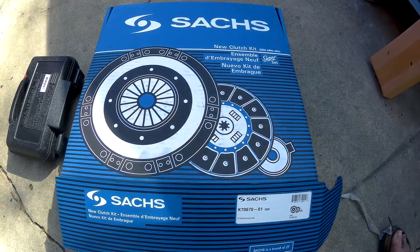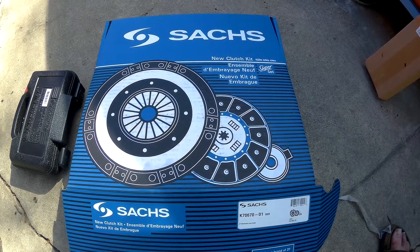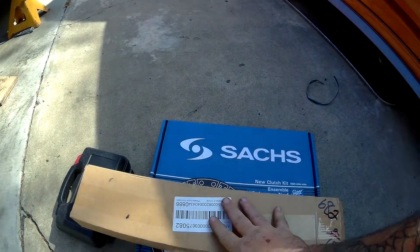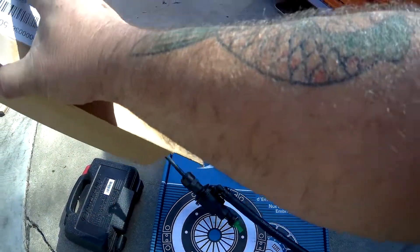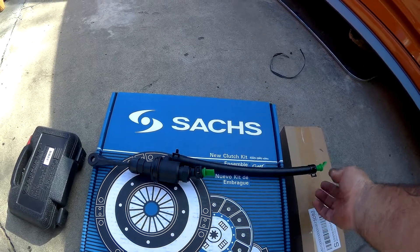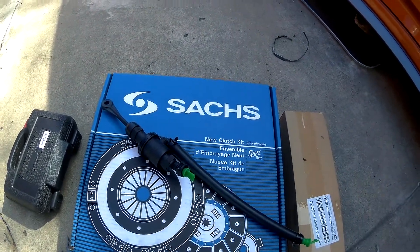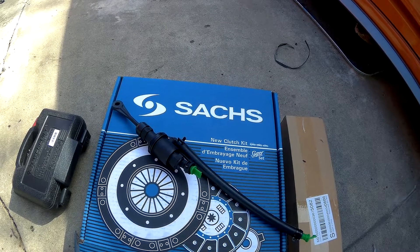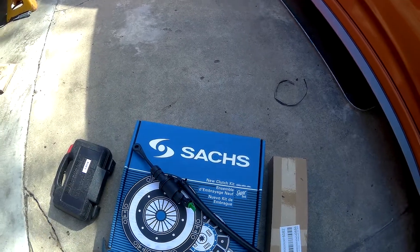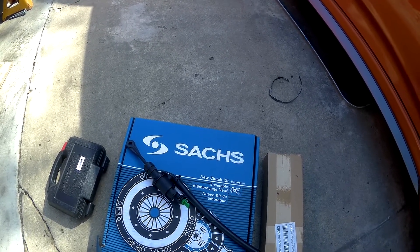I've got hundreds of the plastic ones, but they're for American or Japanese cars and none of them fit very well in this clutch disc. The other part I ordered separately off eBay was $47. This is the part that connects to your clutch pedal inside, this connects to your brake master, and this is the part that actually feeds the clutch cylinder. Since this car has 122,000 to 123,000 miles on it, it was probably better to just replace the entire system. The flywheel looks good — no grooves, no burning — and the springs still feel good inside.